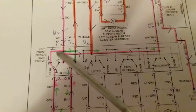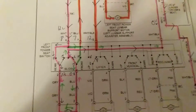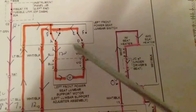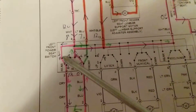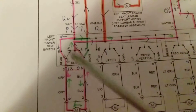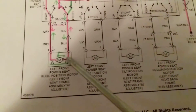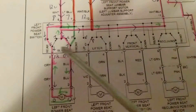We will follow this branch — the pink. I put letters on the contacts because I got an email from someone about how to understand where the contacts are. So even though the schematic does not label contacts, I put contacts labeled A, B, C, D, E, F and I will refer to those by letters. We come down here — we activated the switch in this position. This is the rest position. When we activate it, it goes from G to H instead of I. So the current will flow in this way: come out pin two, go into pin one, follow the pink, come up here.